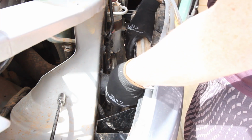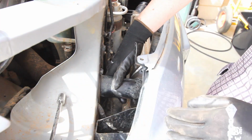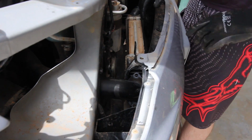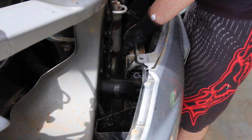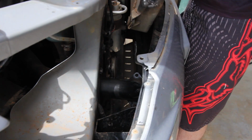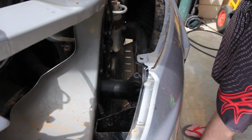Now I can actually move this bolt. See what you can actually do if you want to, get into here and remove this pipe altogether. Three bolts are out. Found an easy way of doing it. Go through the back bottom grill and then you can actually get direct access to the bolt. So I had a bit of a blonde moment there, but anyway. So come straight up, a little bit out, and there you go. Intercooler is out.